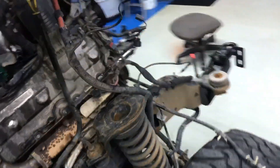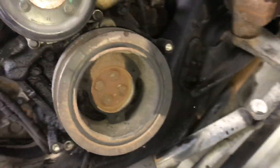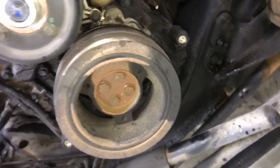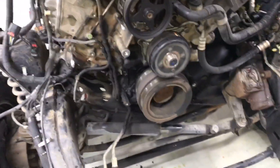Right now I'm getting ready to power wash, so I wanted to show how nasty it is before I eliminate all of the indications. It's looking like a front crank seal — see how it's all wet right there at the top. It definitely looks like a crank seal leaking. I think I might pull the balancer off too before I power wash, clean it all up, and probably go ahead and do the crank sensor and cam sensor.